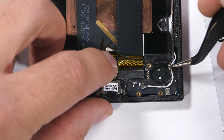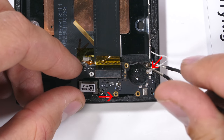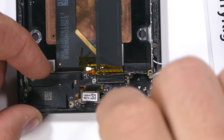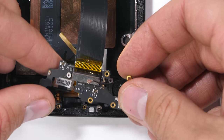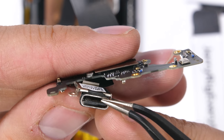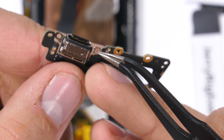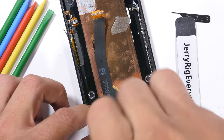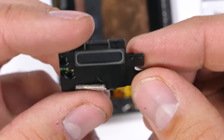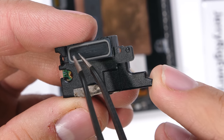The vapor chamber is still covered up by some ribbons from down here on the charging port. There are two screws holding the board in place, and then an additional two screws on the USB-C port portion, then the whole thing pulls up and out. It has a little black rubber ring around the lip of the port for water resistance, as well as minimizing stress on the port when plugged in. The bottom speaker also has its own air compartment and water-resistant mesh over top.